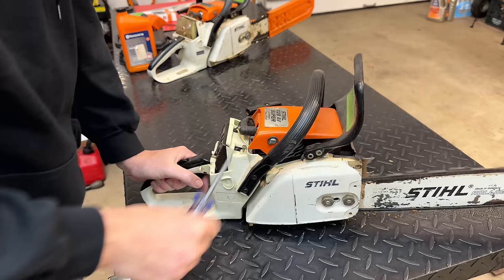I cut the test short because Stanley's saw, even though it has the new chain, was cutting noticeably slower than the Facebook saw. So I want to double check the speed. These engines are rated at 12,500 RPM max. So I'm thinking Stanley's is slow and possibly the Facebook one is fast. So I'm actually going to start with the Facebook one. We'll see what the max speed is, adjust it as necessary, and then do the same for Stanley's.